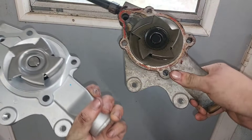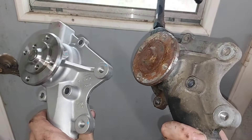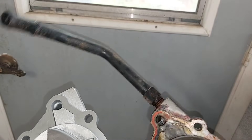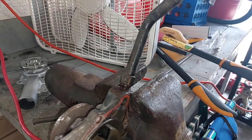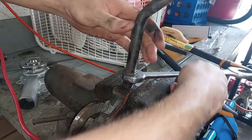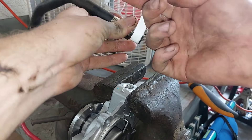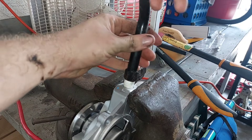Make sure the new water pump has the same bolt holes in the same places and the same pulley. The only difference you'll notice is the pipe, which we need to transfer over to the new one. Using a vise and a three-quarter-inch wrench, remove the pipe from the old water pump. I wrapped it with Teflon tape because I have notoriously bad luck with things like this leaking if I don't, and then just tighten it down onto the new pump.